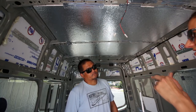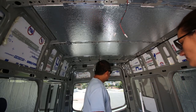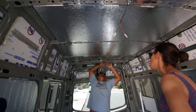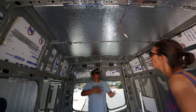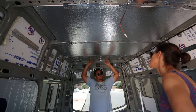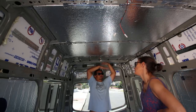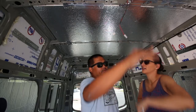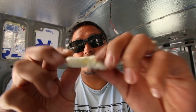Do we need to cut the headliner while it's up? No - what we'll do is cut the hole from the top, then trim the exact shape we need. Or we could just take the headliner piece off - we'll see. We should try to install one of the fans so we can go through the process of seeing how far it sticks out and how much space we'll have from the bottom of the headliner to the fan. If we start there, once we're done with that area we can start adding all the headliner front to back.